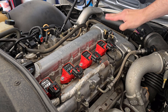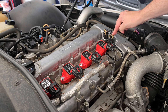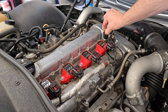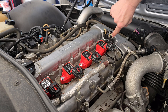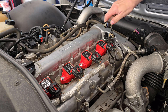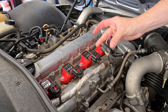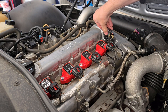When it comes to removing the actuator connections, you'll see these little tan pieces — these are your safety clips that keep the connectors from accidentally coming off. Take them and lift up just like so. Then there's a little black square piece — press that in, then press the tab and pull right up. That's how you remove these connections. Some of them may be pretty seized up, but do that to every one of them.